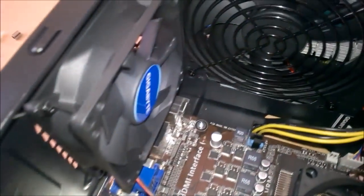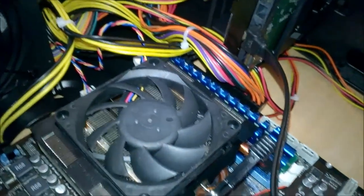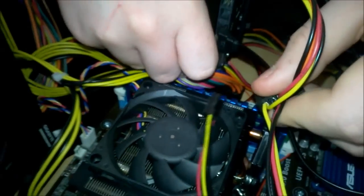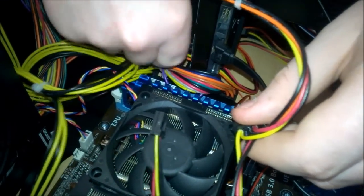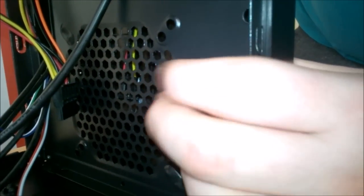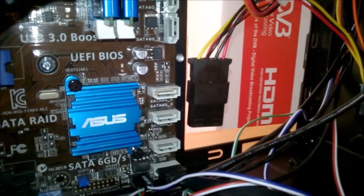That's the rear fan in, and I will hook up our SATA power. Okay, so we have everything wired up now, and it didn't actually turn out too bad. It's a little bit neater than I thought it was going to be. I thought they'd be going everywhere, but on the bright side, we have an extra Molex in case you ever get another 80mm fan to go here. That's what the front intake is for.